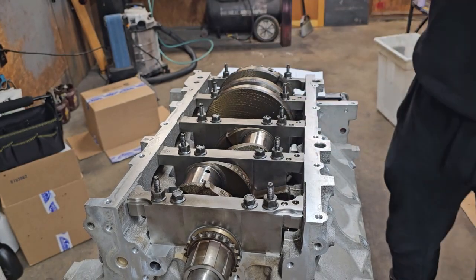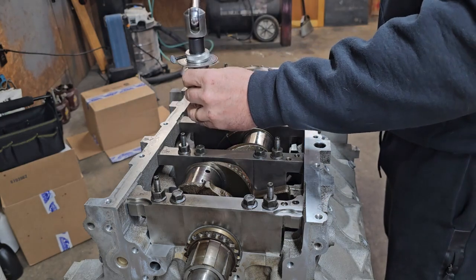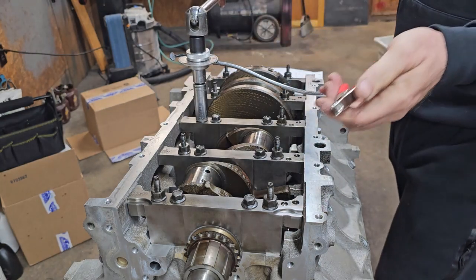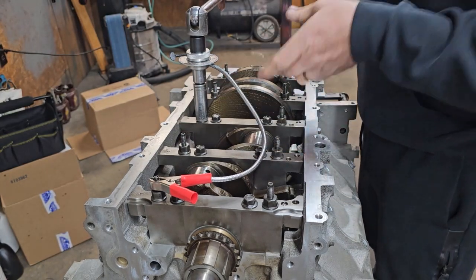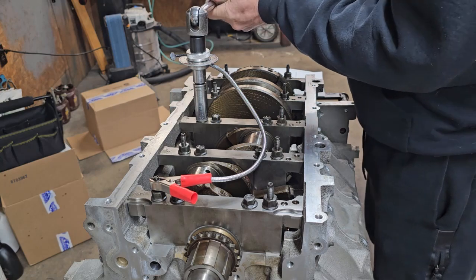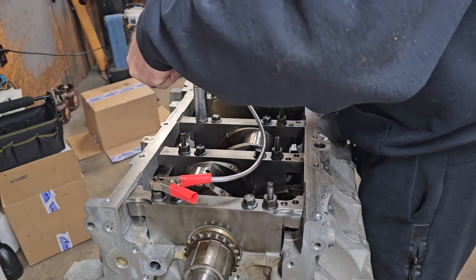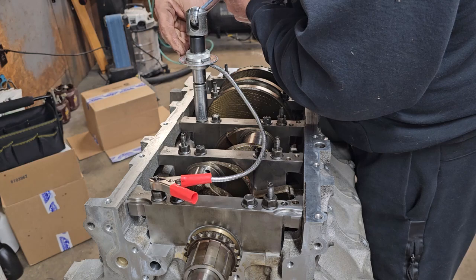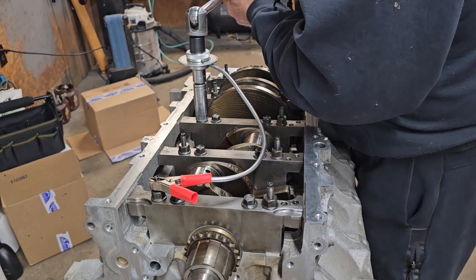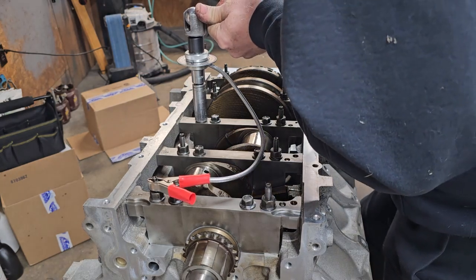Okay, now we'll go back. Same pattern, take them to 53 degrees. I have this little torque degree wheel. I like this kind with the flexible shaft instead of the kind with the rod that just pushes up against something. This one seems to work for me a lot easier. And we'll put that on 0. Tighten the nut down and take it to 53.